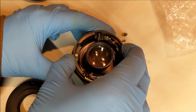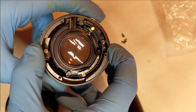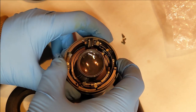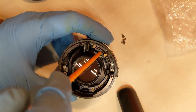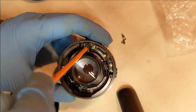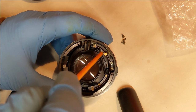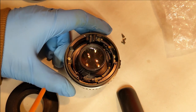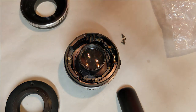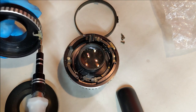It's important to play with everything first, because I need to visualize how the mechanism is supposed to work — I've never worked on a complete Pancolar before. The first thing I notice is that it's definitely something to do with this little lever, which must be the aperture control. Of course it's not working because the pin needs to be depressed, or the switch needs to be thrown by that little wheel. But luckily everything looks okay — we just need to replace this one part.